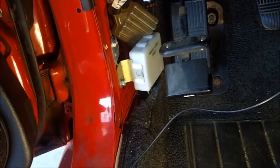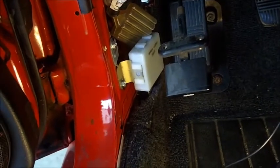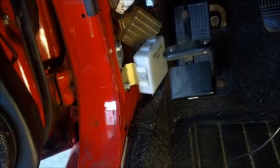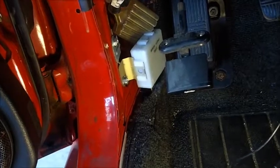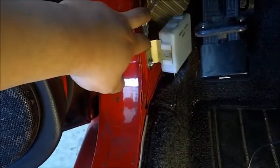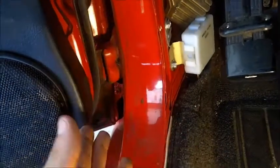The next thing you want to do is find a ground location. I always ground my unit first because if you don't ground it first and start cutting in all your power connections, you can get weird stuff happening — like lights randomly flickering, or the unit trying to source a ground wherever it can. The best place to ground is in the driver kick panel. There's usually a nice flat piece of metal, or sometimes factory screws you can use. I'll be drilling my own with a self-tapper. It's important that you scrape the paint down to bare metal to get a nice solid ground.